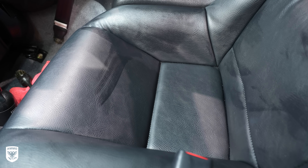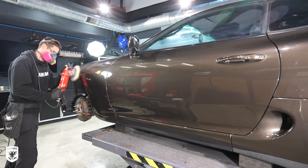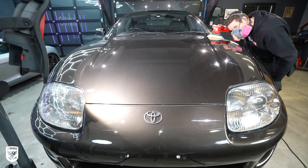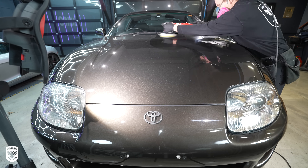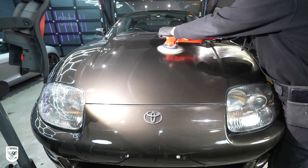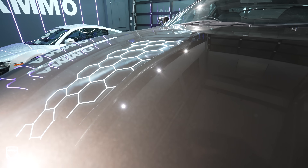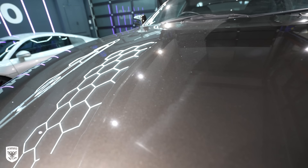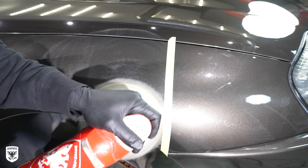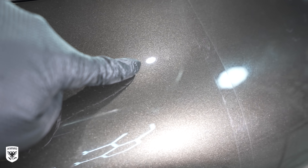With the interior now looking good, I worked on polishing the paint with my Rupes 21mm Dual Action Machine, polishing fluid, and a wool cutting pad. The before and after was huge — just look at the depth and clarity from left to right. What's super fun about cars this rare and coveted is that a full paint correction can increase the overall value of the car by about five to eight percent, which can be thousands of dollars in a buyer-seller transaction.